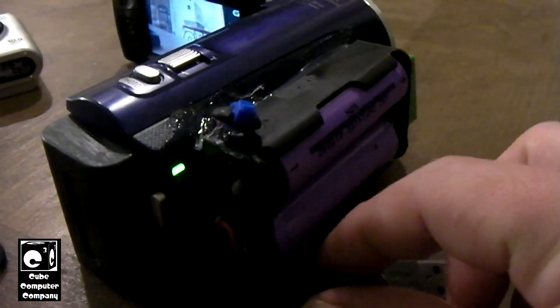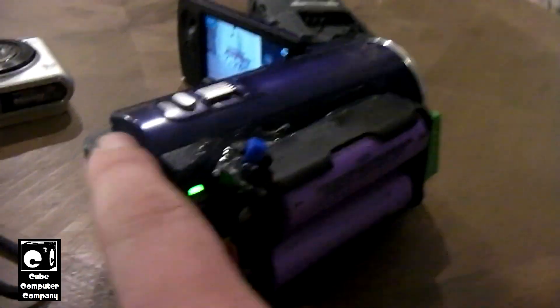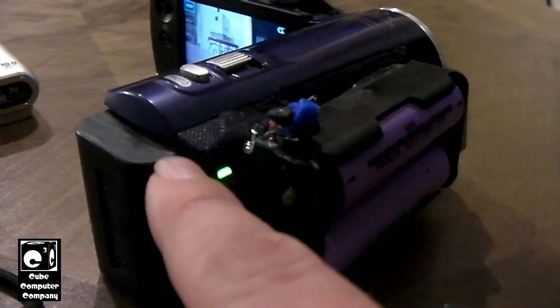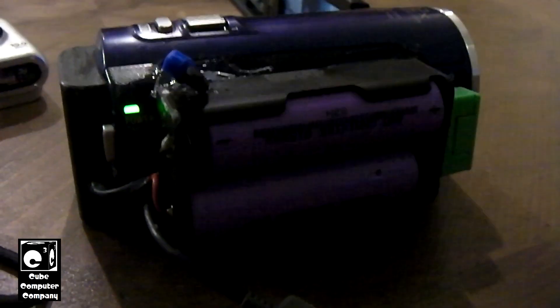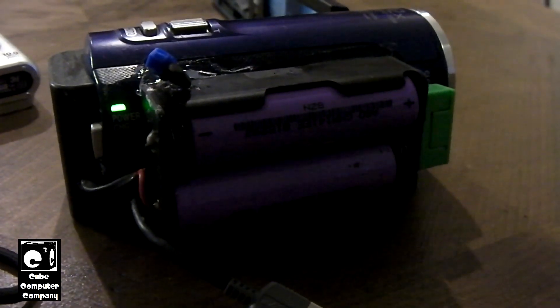So of course, as I mentioned, it's 18650 modded, and the 18650 mod was a bit more complex. I had to retain the original battery pack — the actual cells are longer in there — and I 3D printed little cylinders to replace them. I'm retaining use of the stock BMS board so that it monitors both of these cells as they're in series and makes sure they're balanced. Not something I recommend doing if you are not knowledgeable of lithium-ion chemistry — it's a bit more advanced of a modification. But there's a second modification I've done to this camera, and you can see it right there. This right here is the replacement timekeeping cell.